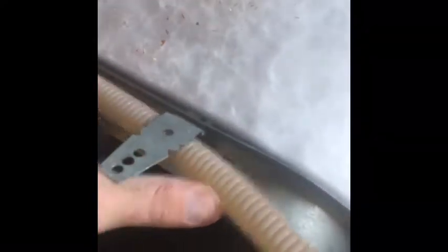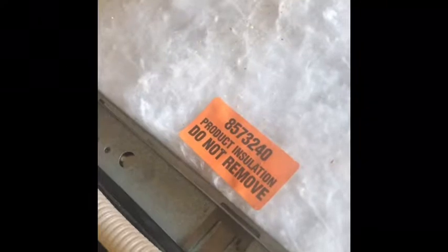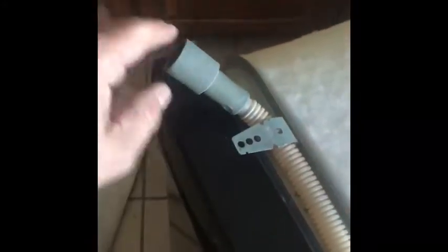All right, like I said, here's your drain line. And right now, it's about halfway full of some nasty, nasty water. So what I would recommend is to stick it underneath your clamp right here. Push that down, because you won't be using this again. And then find you some tape, just as a safeguard, and put it over the end of it right here, so when you remove it out of the house, you're not dragging that nasty water.